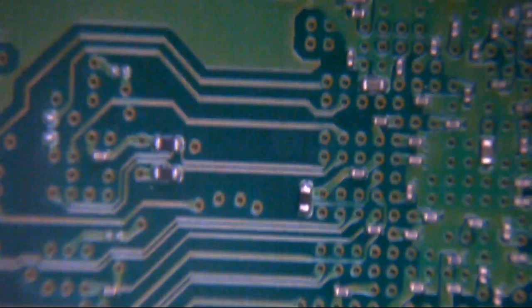I mean, that's going to Southbridge, isn't it? If you follow it down there, losing focus a little bit. Yeah, it's going under the Southbridge to the Mediacon. I don't know what sits on that line. What does sit on that line? That's from the Blu-ray drive. That is from the Blu-ray drive. Yes, it is. That's going from the Renesas IC. So the lines that have been cut through.